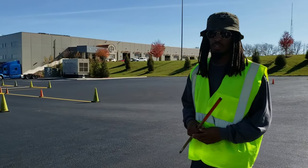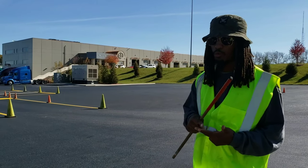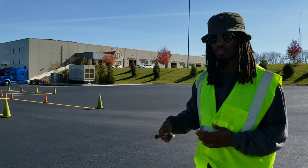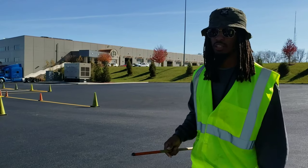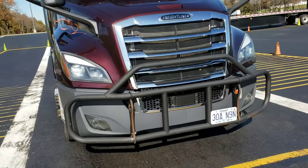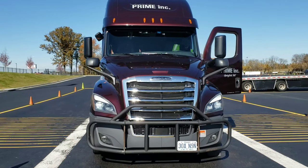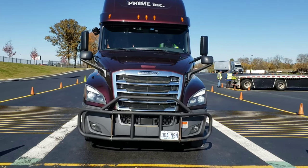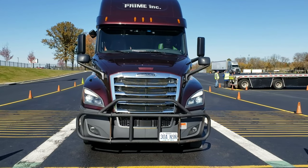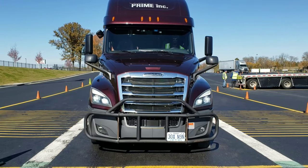Now I'm going to ask my examiner to help me check my 5x5s in 5 different locations. That's going to be my left turn signal, right turn signal, my 4-way flashes, high beams, and brake lights — in the front of the truck, both sides of the truck, rear of the truck, both sides of the trailer, and the rear of the trailer. So now I'm going to go check. The examiner will give you a thumbs up, and until then you don't turn the light. Left turn signal, right turn signal, 4-way flashes, and high beams.